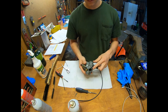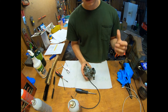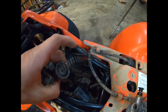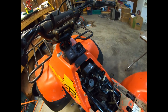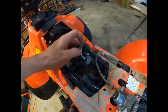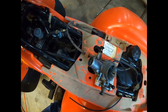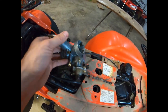Now I'm going to show the slide and slide needle. I cleaned the needle up and also cleaned up the other choke plunger, which is from the cable up here on the handlebars. Everything seems to be working. To install it, this plunger has to be pulled out — put that in there, and put the boots on and we'll be done.